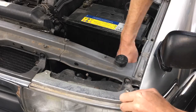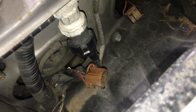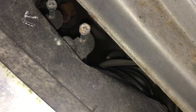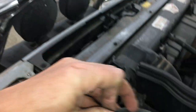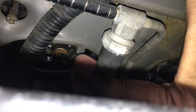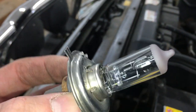Things got off to a rough start — the plug was really stuck to the back of the bulb; that was a pain. There's a little rubber tab on top of the headlight that I need to pull back to remove the rubber cover. Eventually it'll start to come off — might need a little push with a screwdriver to get it moving. The black plug was in the way, so I unplugged it — looks like it's something for the AC unit. Now I can grab the rubber cover and pull it out of the way. Back here there's a thin metal clip that latches into the housing and holds the bulb in place. I unlatch that, swing it out of the way, and pull out the original halogen H4 bulb. You can see it has the dual filaments for the high and low beams.